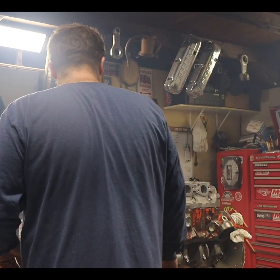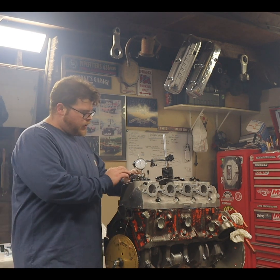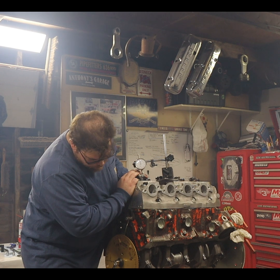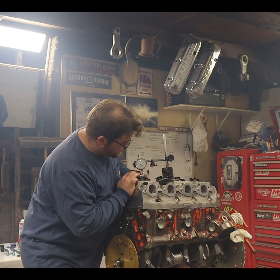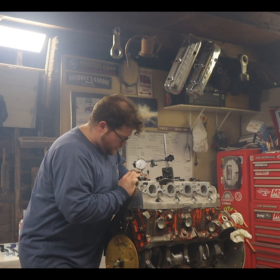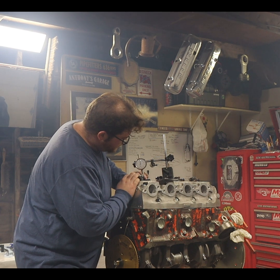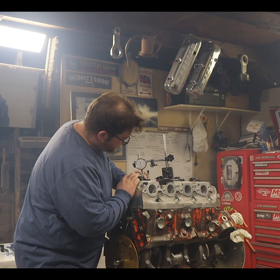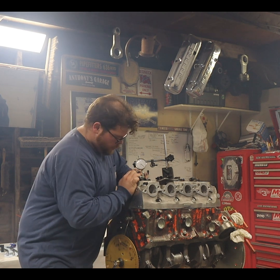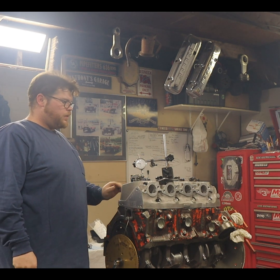188 was our tightest point. Now at five degrees after top dead center, re-zeroed out our indicator. If it keeps getting bigger, I'm probably not going to check 15 and 20. One, two — 260. It's getting bigger and bigger, so we don't need to check anymore.